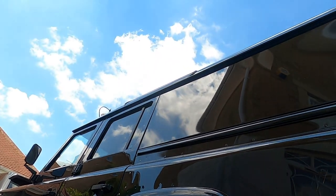A similar thing is happening all around the car with all the large panels. Because it's a utility vehicle, the rear doesn't have windows, so it's just larger sheets of metal. They vibrate a lot, so you do need to put sound deadening in to calm it down.